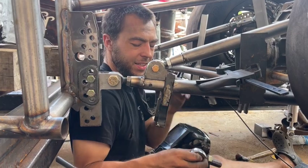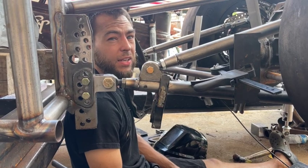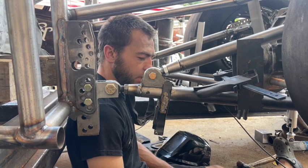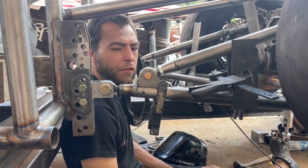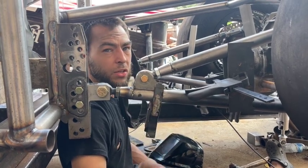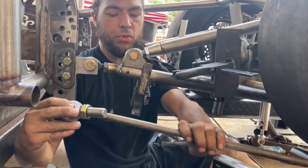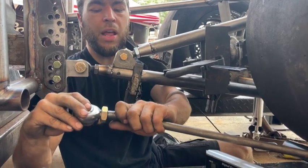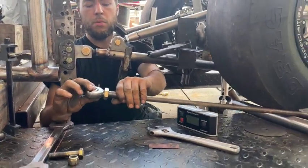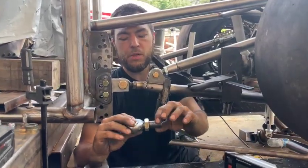In this setup we're using four heim joints instead of just one, which takes a lot of the load off a single vertically-mounted heim joint. The reason I did it this way is because we run a lot of travel. As you can see, to get the amount of travel we need with this amount of articulation, a small heim joint on the chassis for a single-point setup doesn't have that much articulation. For big tire cars that don't see a lot of suspension travel, it's not that big of a deal.